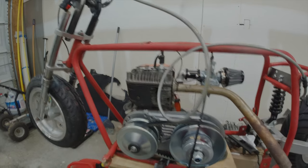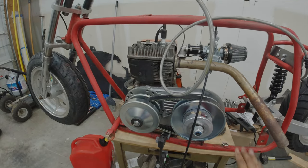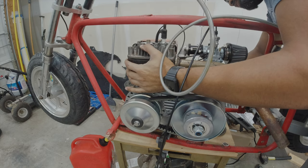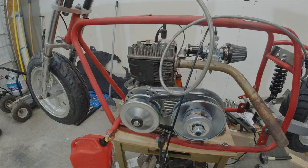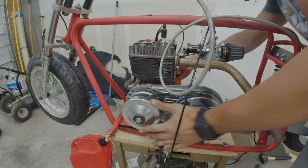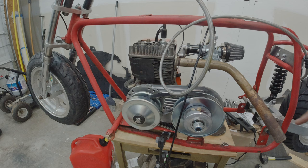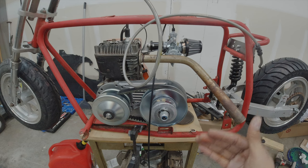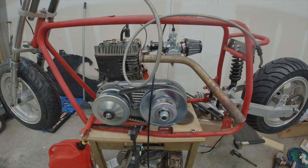So, now that the bar is gone, the motor is basically as far back as I can get it. Next thing up is I ordered some more 420 chain because I didn't have enough. I use RK 420. There will be a link in the description. So once I get my chain, I can sit the motor to where it's aligned with the rear sprocket. I can drill the holes in the motor plate to bolt it down.